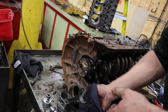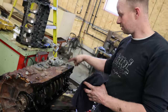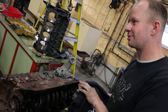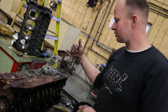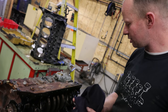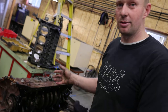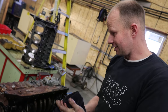So, everything wrong with the OM606: the valve or timing chain setup — unless we're missing something, maybe there's a master link on the chain we missed — and those stupid pins going through for the timing chain tensioners, and those stupid plastic hoses. And that's it. Get past that, you've got yourself a stout little engine. What you need to do is buy a good running one that's already turbo, just throw a turbo and a pump on it, and send it.